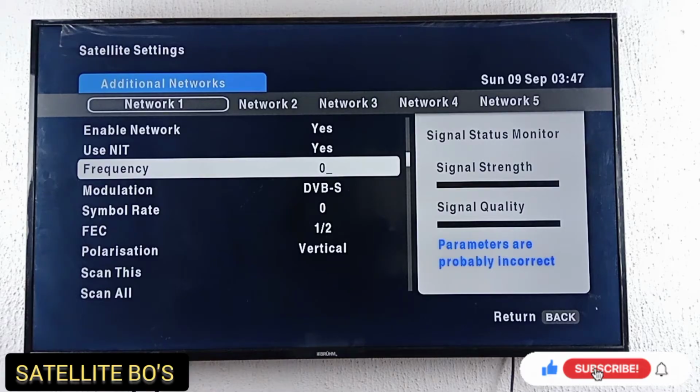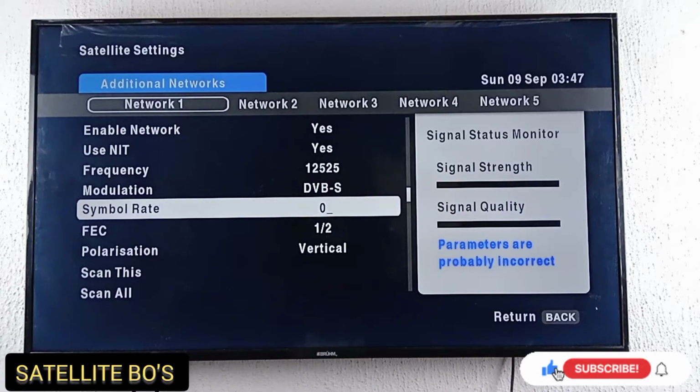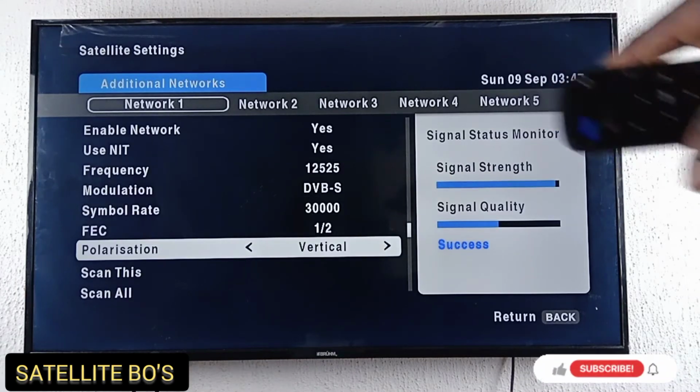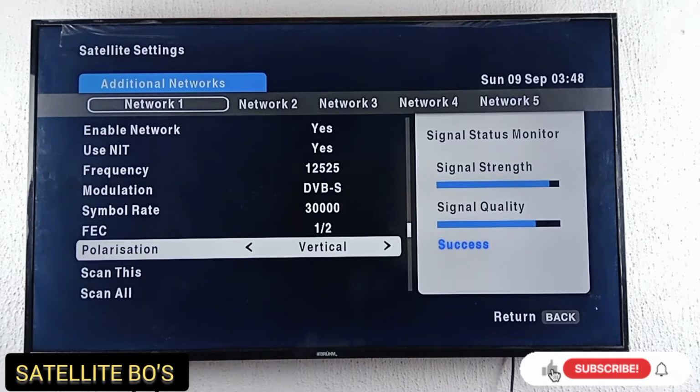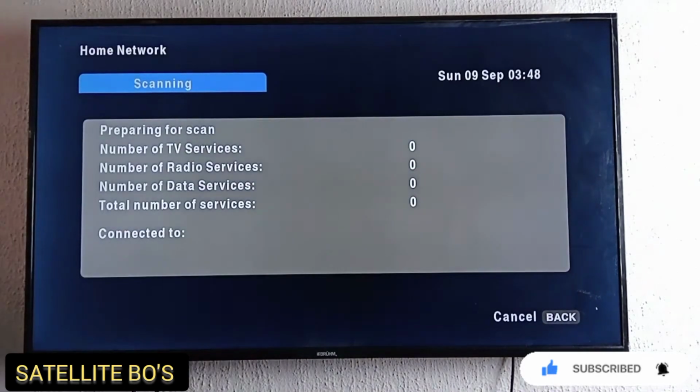Now you go to frequency. One of the first frequencies we saw was number 4 there, that's 12525. Modulation is DVB-S, leave it there. Symbol rate is 30,000. Polarization is V. You see the signal strength has come up. The signal quality also has come up. So just go and scan this. You see, it's scanning.